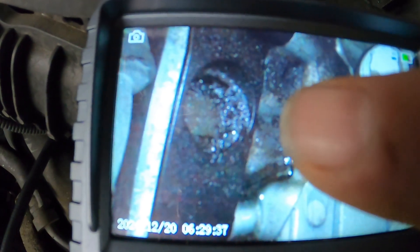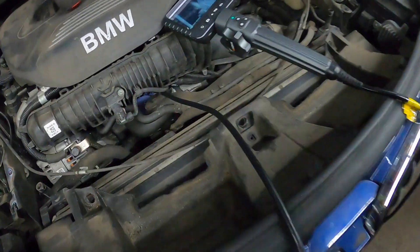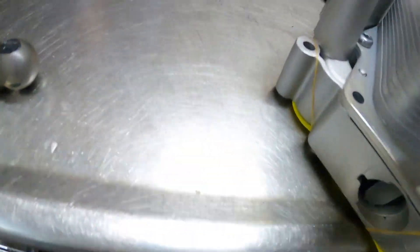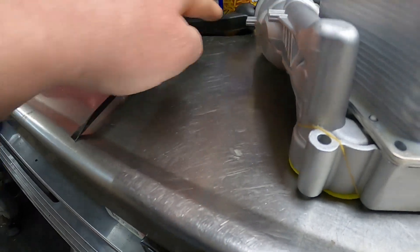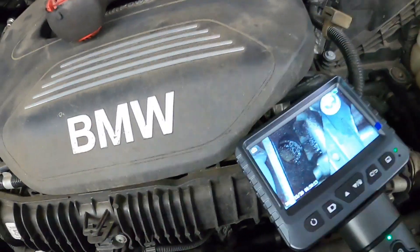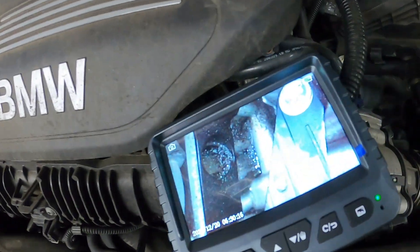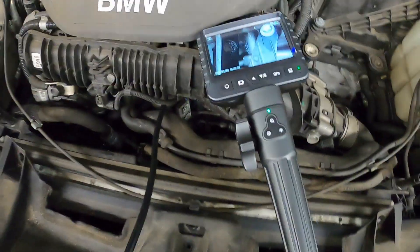This is the top of that oil filter housing oil cooler. Basically it is leaking right in this area — leaking right where this piece meets the block of the engine, then it's running down this side and dripping, and you don't know where it's coming from. I gave it a couple pumps — can you see it bubbling more? We have now confirmed the problem.